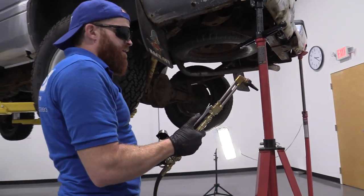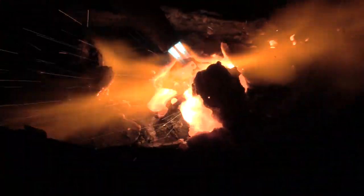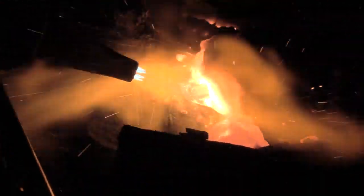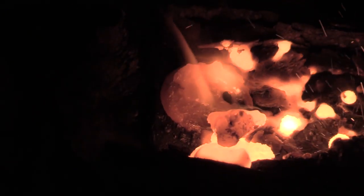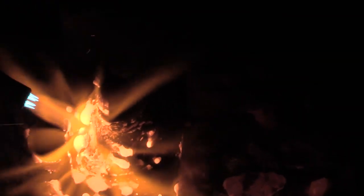All right, here we go on the other side — flame on. There we go, time to go away. There we are, bolt number two. Make sure I get the rest of it right there. Last one. At this point you want to be super careful because there isn't going to be anything holding the bumper into the vehicle aside from a lot of rust and, of course, the stands or whatever it is you use to support your bumper.